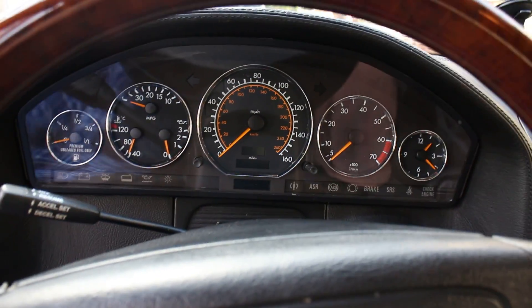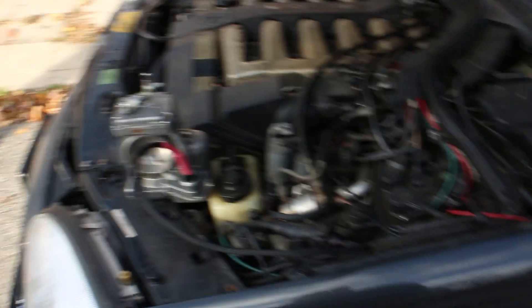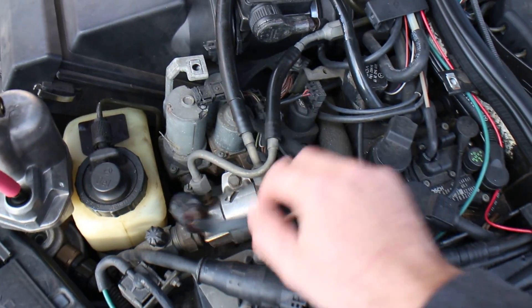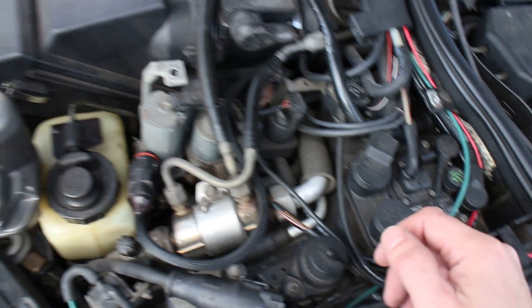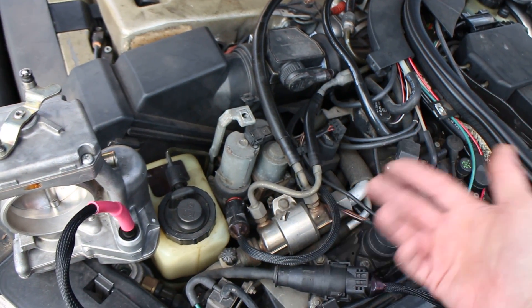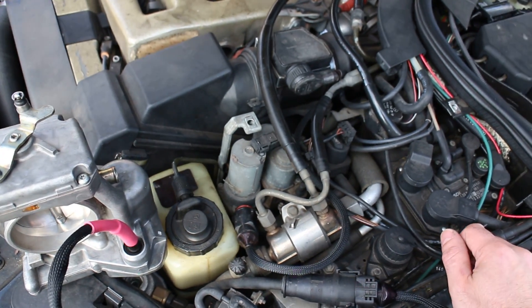What I'm doing here is I have two throttle bodies that I built for a customer, as you can see connected to my vehicle. My units are disconnected, so I'm going to induce limp mode by pressing on the gas pedal with my units not connected to the computer. The computer will see that I'm pressing on the gas but because it's not connected to the linkage, it will trigger limp mode because the throttles don't open when I press on the gas pedal. Let's see how that all works out and how the engine runs in limp mode.